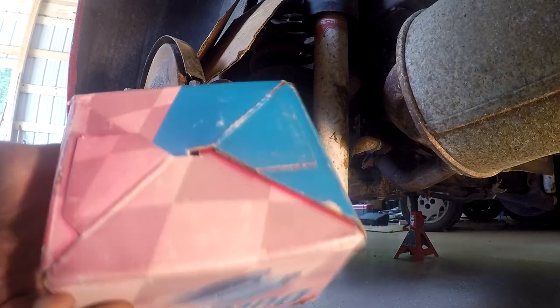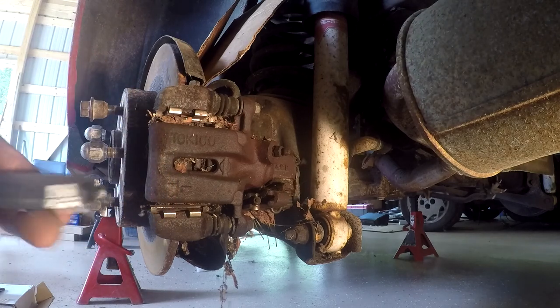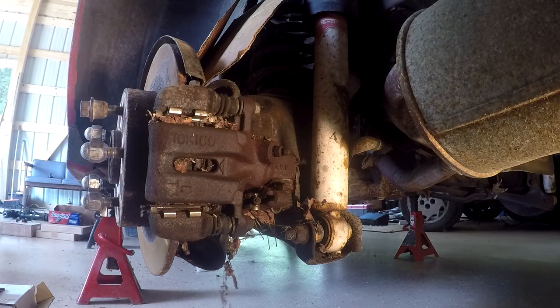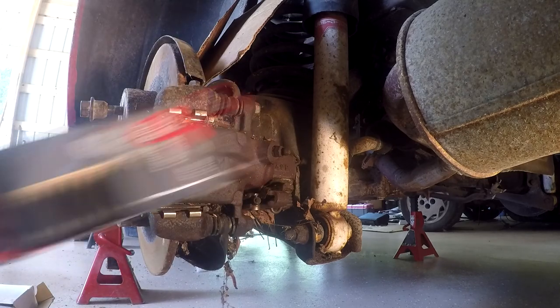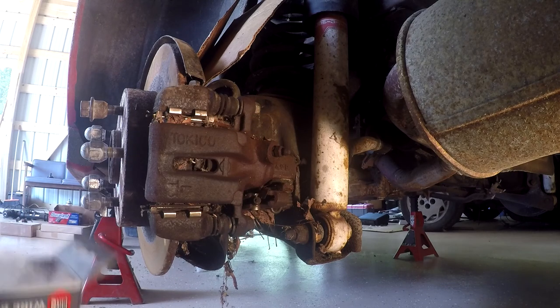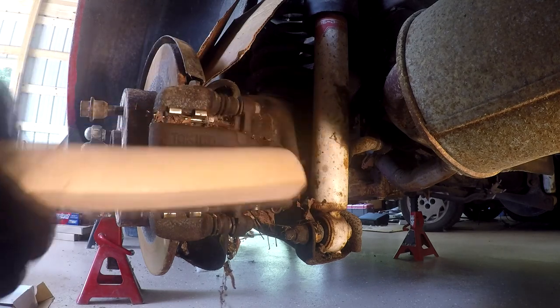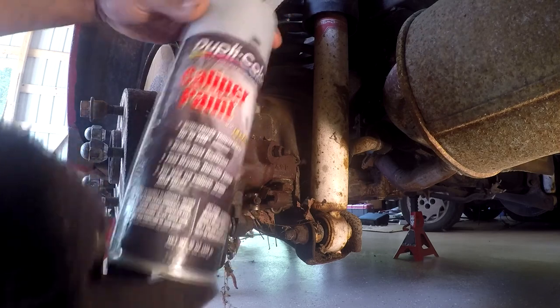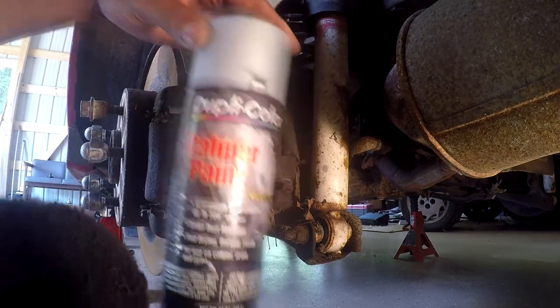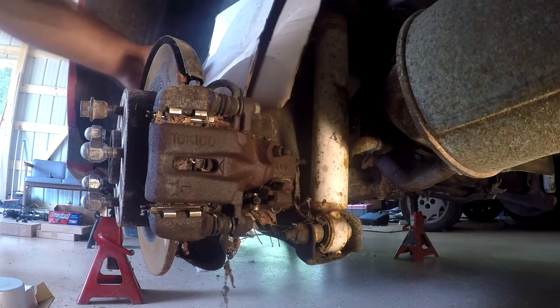The good news is that we got some pads that were actually in the car. The box is really faded but while I was rummaging through the car I found a new set of rear pads. It looks like somebody was on the way to doing a lot of things to get this car in top shape, so that saved me a lot of money. Because this kind of just looks ratty, I'm going to go ahead and wire brush everything off. I bought this wire brush from the parts store — it was like $4. And I'm using some Duplicolor caliper paint I had sitting on my shelf, with a piece of cardboard so the paint doesn't splash everywhere.